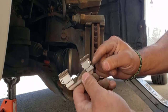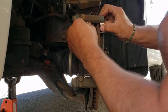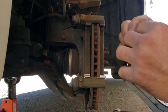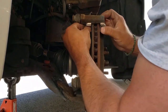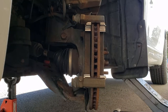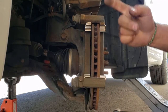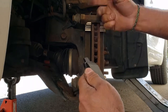The slides will simply fit in there with these little tension clip springs locking into them. This one looks damaged. Take the old pads off. You want to orient the little finger — the wear indicator — so that it's dragging. The rotor spins forward most of the time going down the road, so you want that on the trailing edge of the brake pad. So this will go at the top on this vehicle.